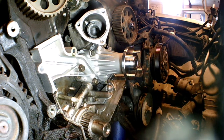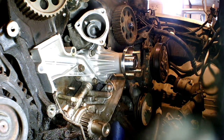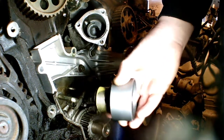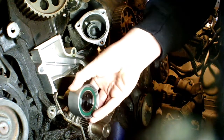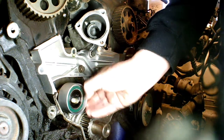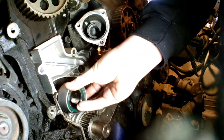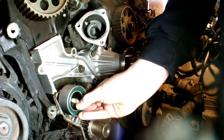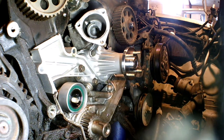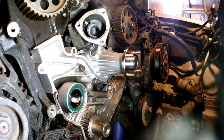Our next project: we've cleaned this off, inspected behind it, and put the water pump on — that's drying. I'm going to put the new tensioner and spring on. You want to be sure and line that up. There's a bolt in here that holds the spring pretty much steady. This is the new spring I got — it's actually a Nissan genuine part. Got it from partsgeek.com. The part was five bucks, but with shipping, insurance, and a four-year warranty on the spring, it came to about $19. Which is probably going to be a lifetime with Nissan parts.